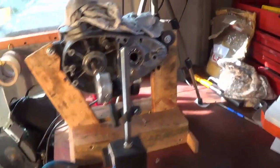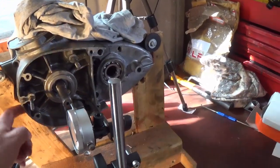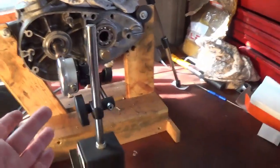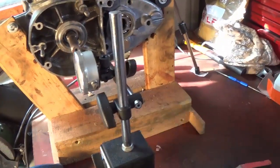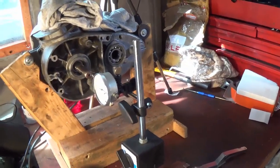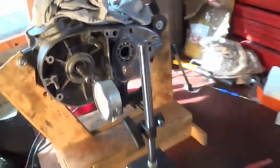It's all set up to measure the engine. I'll try this method first — put a few screws into the cases to tie the two cases together and bolt them up. I've got this dial gauge and I'm clamping the engine stand down onto the table so it doesn't move when I move the crank back and forth. The other method, if this doesn't work, is using feeler gauges in the top.